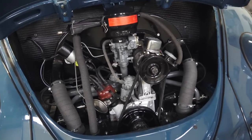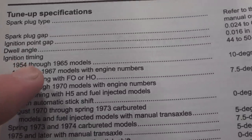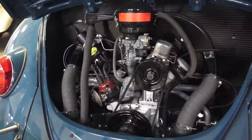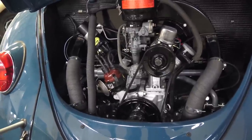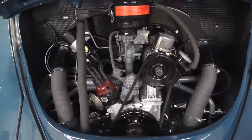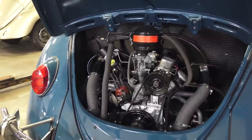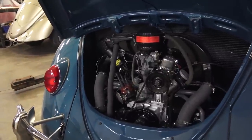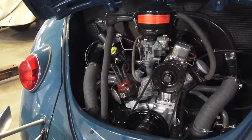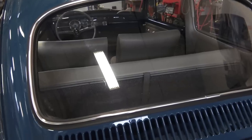Get your specifications manual so you can see it's 8 and 12. For ignition timing with the correct distributor — we have the correct distributor here for the 40 horse '65 motor — it is actually 10 degrees before top dead center. Many guys say seven and a half degrees, and yes, when you change to an 009 or taller distributor, seven and a half degrees before TDC seems to be the way to go. But if nothing is modified and you're bone stock, go with 10 degrees before TDC. We completely rebuilt this motor and put a big bore piston and cylinder kit on it — no machining of the block, everything still looks stock, but now you're up to a 1385cc as opposed to a 1200. I took it for a drive yesterday and it's just beautiful.